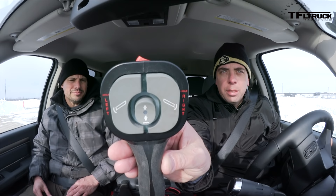Grab hold of this controller so you can shift on the column and steer with the same hand. The idea is to position it so you can operate the plow controls — the buttons — and also make forward and backward shifts, because when you're plowing, you're doing a lot of forward and backward movement. The buttons include an on/off switch, left, right, up, and down.